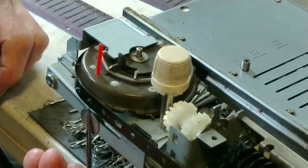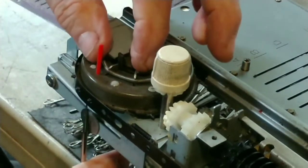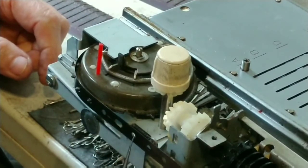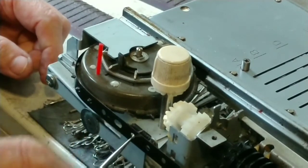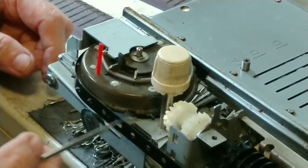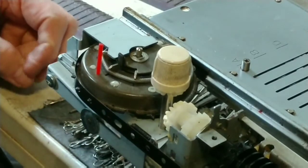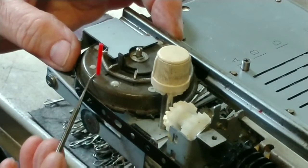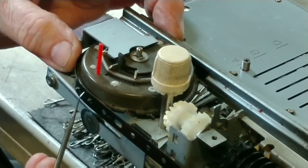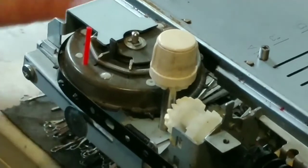You can also see the reference of this little disc right here. My straw — if you'll look — it's between two of the little holes. We have a series of little round holes, and then we have one oblong hole right there. The oblong hole is where the carriage ties into the belt. But now look — if we come around to 12 o'clock on this timing mark, we're between two round holes. There's no way for us to tell which two round holes we should be between.